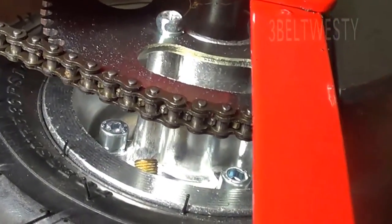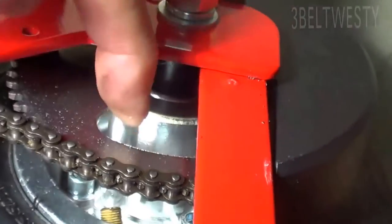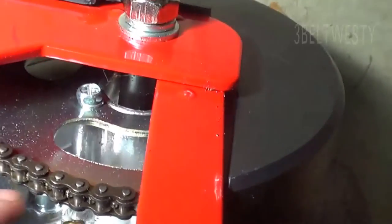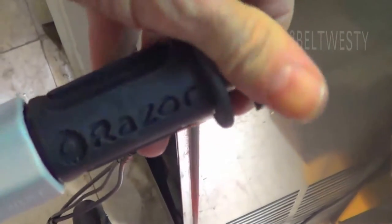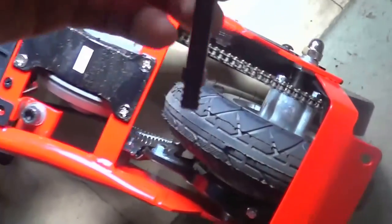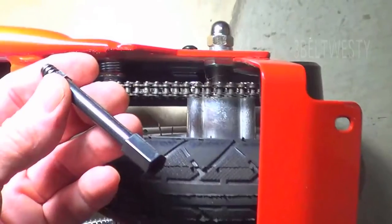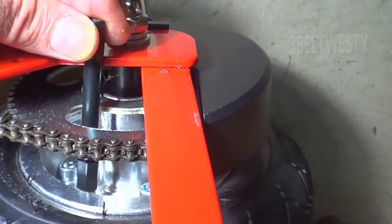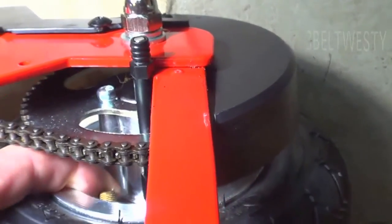This is the Red e250s Razor. The valve stem on here is kind of cocked over, so when you put the extension piece in to line up and fill it with air, it's a problem. The extender is hidden in the handlebar grip here. I'm gonna stop the camera and see if I can feed this in and see where it lines up. Since the valve stem is cocked over, I can't get this on.